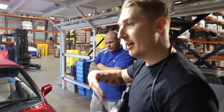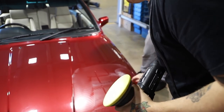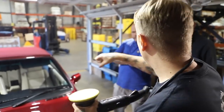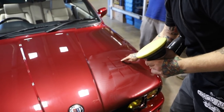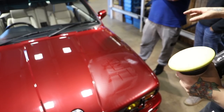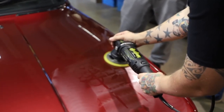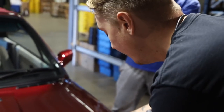So you know I've been teaching you about the up and down, left and right — exactly the same with machine polishing. Up and down, left and right, essentially creating a hashtag pattern. You just want to do two very slow passes, about an inch per second. You see people with rotary polishers going as fast as they can because it generates so much heat. A rotary polisher spins on a central axis, but a DA oscillates, so it's never really in one place at one time. I'm going to go in between speed 4.8 and 5.8 — that's as fast as you want to go. Going faster means it's not giving the product time to work.